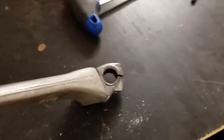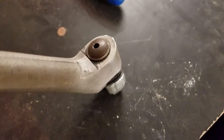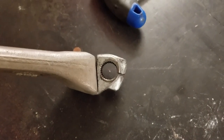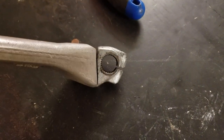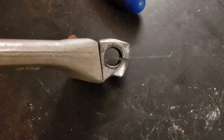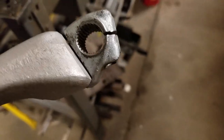The early GasGas kickstart pedals: the 1996 JTR370 was the first year for the 18mm diameter shaft with the tapered pedal attachment, but this is all 1996 and older other than the JTR370. It uses a 16mm shaft spline with a pinch bolt, and you have to maintain these parts, make sure this stays tight — because there's really nothing left, everything's obsolete.